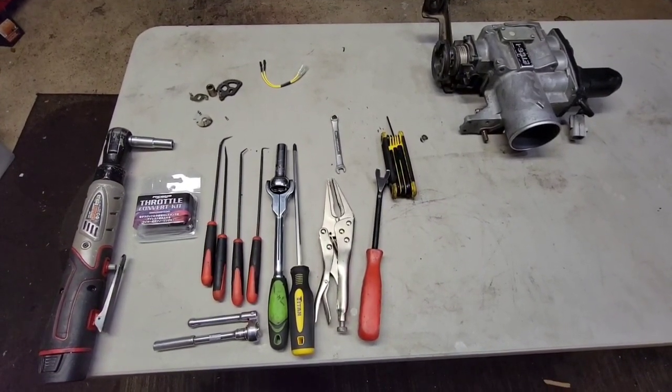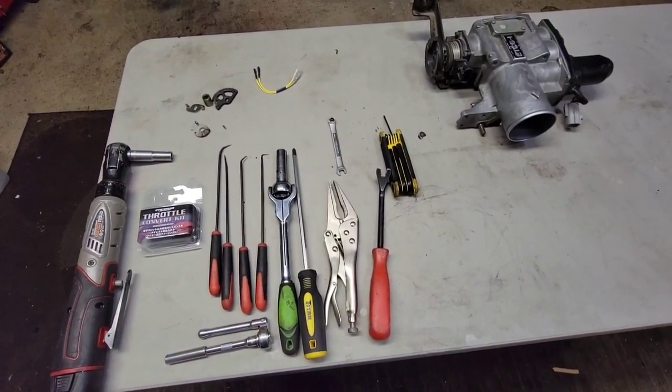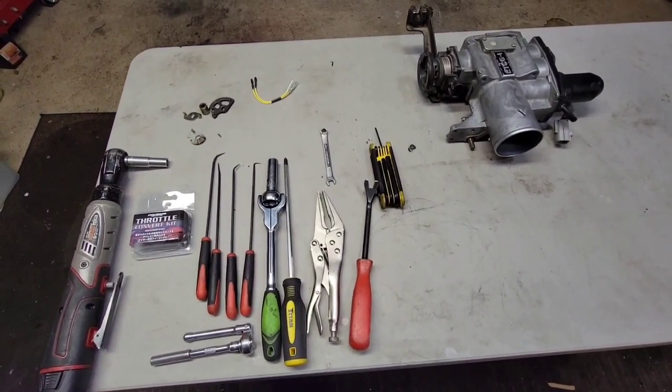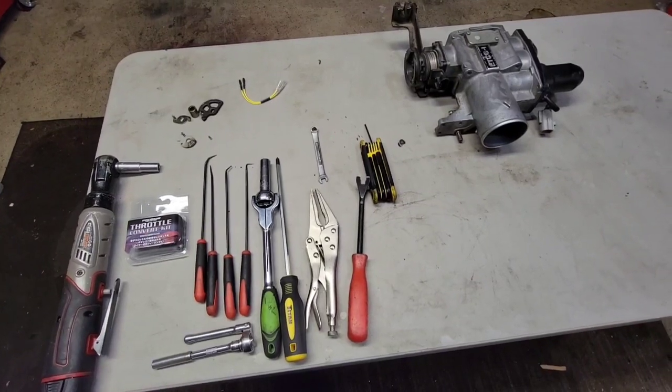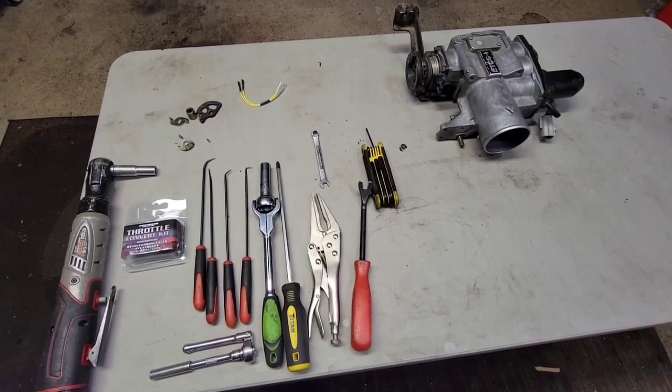I've tried the throttle lock by itself, it works really well, but the way that the throttle body and the throttle motor are controlled in the stock throttle body, it puts a lot of stress on the APPS sensor and the throttle motor itself, because the stock ECU is trying to fight you opening the throttle.